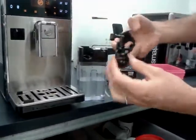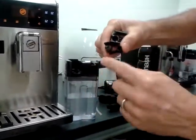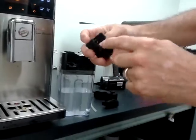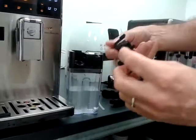Just pull the rubber off. You can see milk can build up around these areas — these need to be clean. Injectors, injector tube, where the milk comes in, infusing chamber, spout. Wash, then to the back.